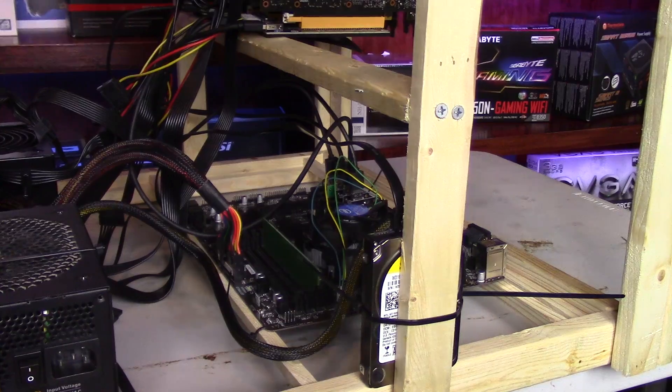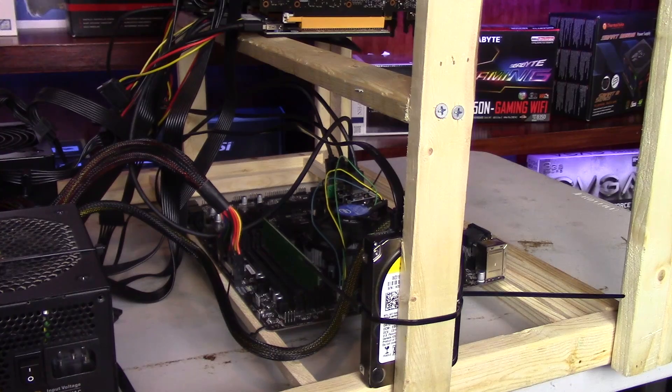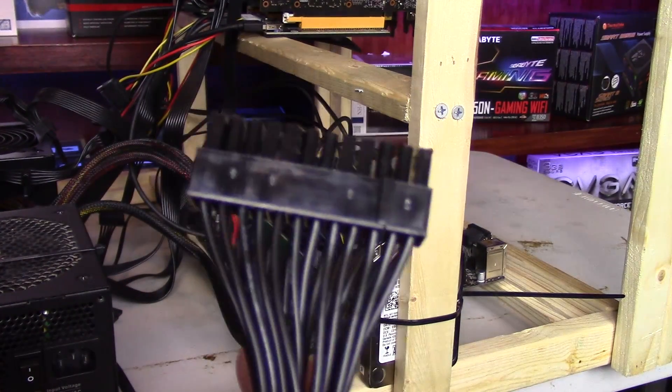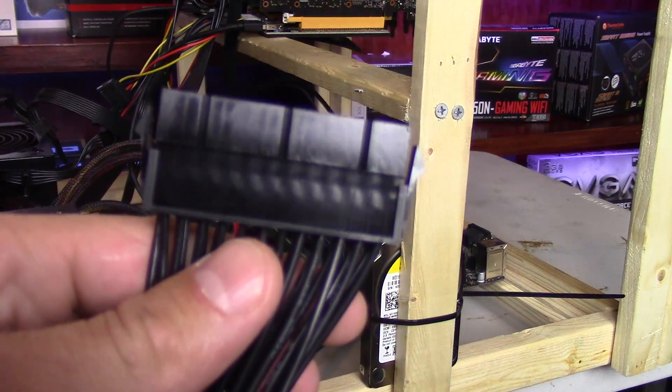To let you guys know what you need right off the bat, it's just going to be one single part that you can pick up at USA Miner Depot — I'll leave my affiliate link in the description below, as well as an Amazon equivalent link. Essentially what it is, it's a 24-pin power splitter. The only difference is the secondary power coming off the splitter only has two cables or wires going into it. That's because all it's doing is tripping the second power supply to turn on when those two cables make connection — that signal is coming off the motherboard.